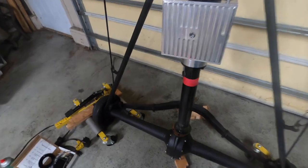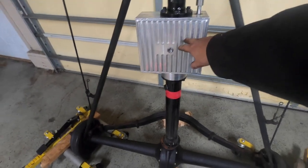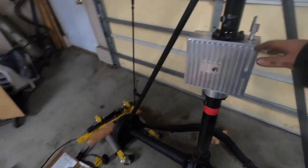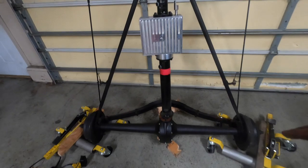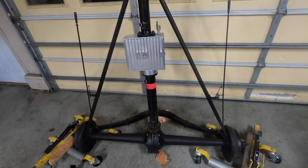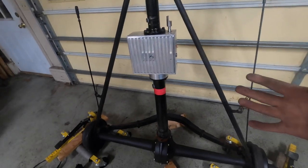This is where you should end up — I have the overdrive unit installed on the driveshaft but not yet engaged, so it's sitting kind of high. Where we installed the coupler, we need to line up the splines with the overdrive unit and the driveshaft. This takes a bit of work and unfortunately I won't be able to get it on camera, but I like to just grab the body of the unit and rotate it around until I get those splines lined up. Once you do, everything should line up and the whole unit should set down right on the gasket.